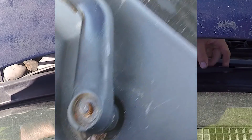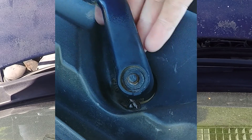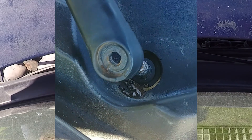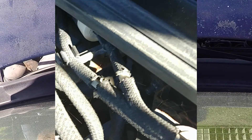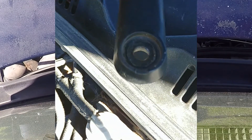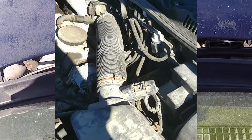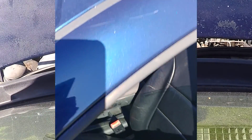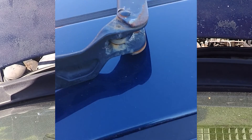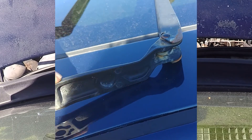The hard part with this one is that the wiper isn't up, so you can't tip it up to remove the arm from the pin. Of course it's spring-loaded, so you just have to be careful you don't hurt the spline. There's a bunch more rust dust again. Make sure the splines are super clean before reassembling. These arms are different - I don't believe you can put them on wrong. The passenger side one has a bend in it whereas the driver side one is pretty much straight.